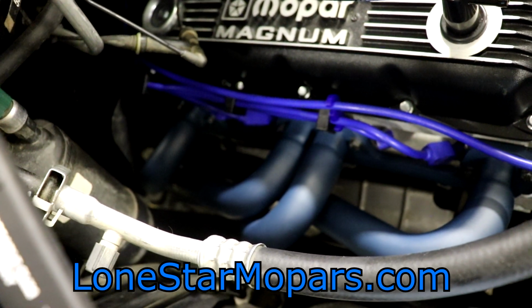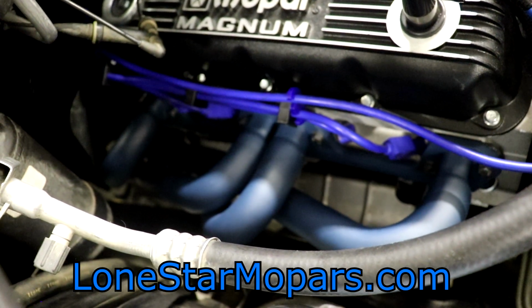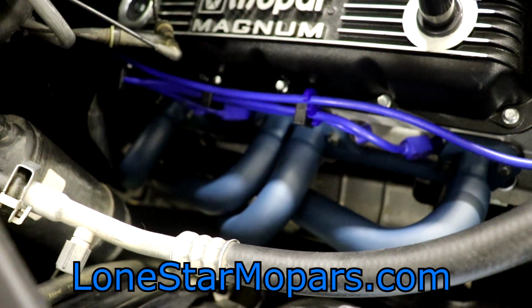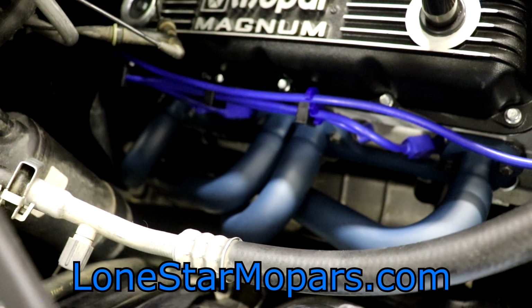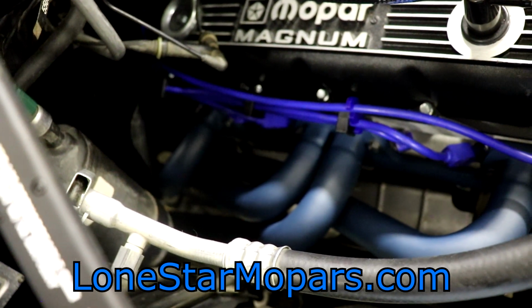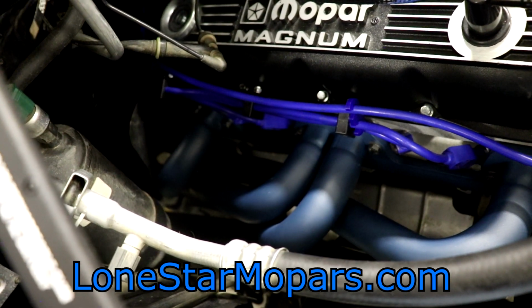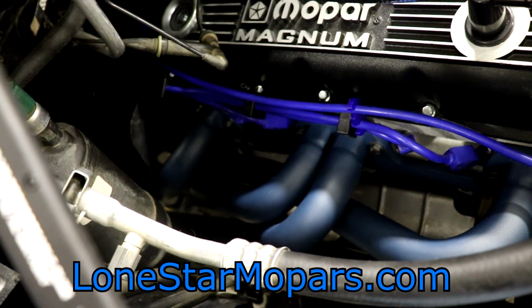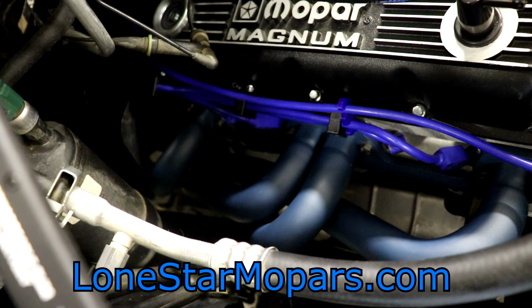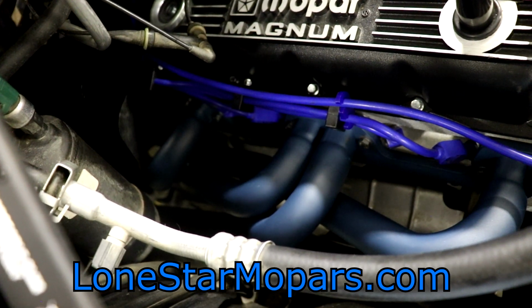Yeah, I don't know what to tell you. I would assume people that watch this for a guide could do this, have bolts drop all the time, and if you have a bolt go down in the catch of the primaries, like where they all four nest together, don't use your good magnet, get your cheap one, like the 99 cent from AutoZone's counter, and use that, because you do not want to experience what I experienced. It's a major setback in terms of time. Kind of funny, but also sucks at the same time.